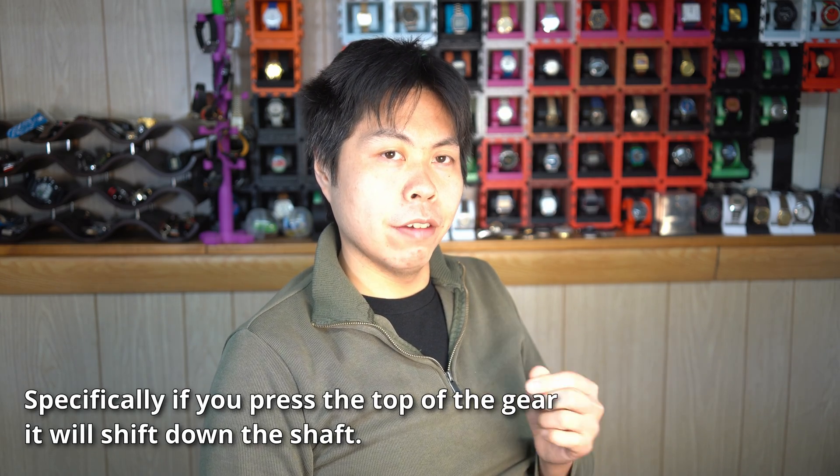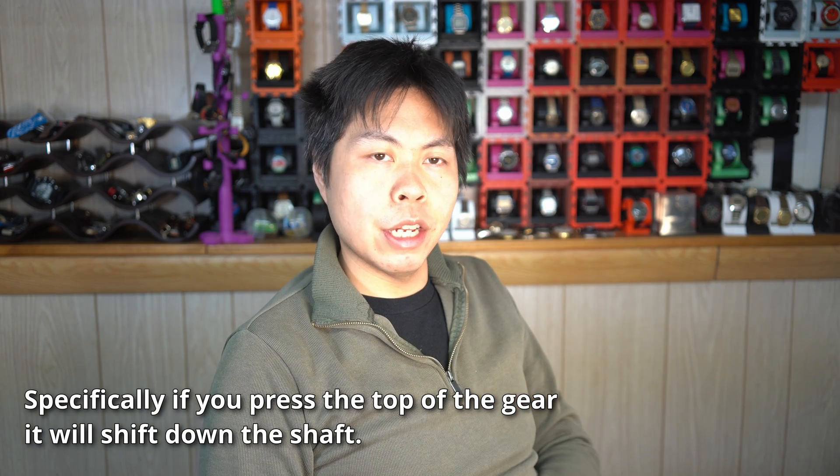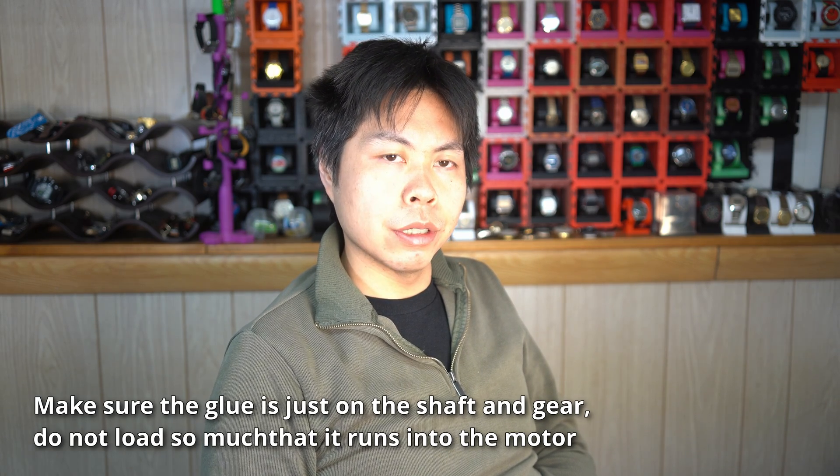The solution, which is fairly quick and easy, is to actually find the one that's broken. It's usually the one that's kind of moving or easy to move with a pair of tweezers when you take the thing apart. Essentially all you've got to do is put a dab of crazy glue on top of that, make sure it dries, and it'll fix itself back to the shaft and your IBIS should be working again. Chances are the gear has developed a crack and isn't gripping the shaft well — ergo, crazy glue is needed.